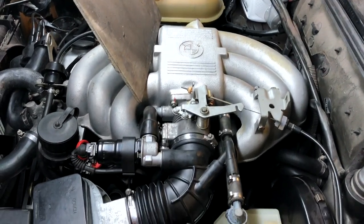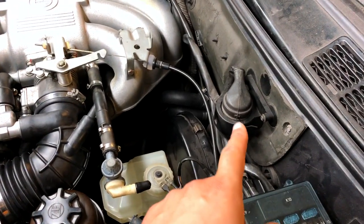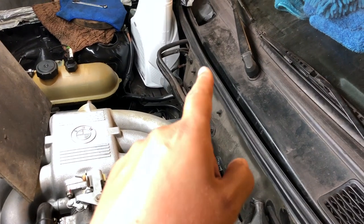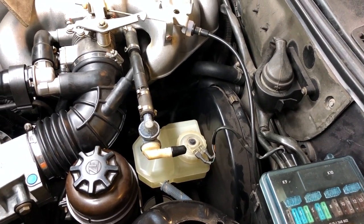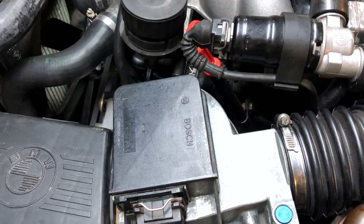So I checked the plus cable, the green wire on the coil, that checks out, everything is good there. I checked the continuity for wires in the C101 socket, that all checks out. I checked the small positive cable that runs from the battery and the fuse, that all checks out, so that's all good and great. And then I was measuring some things at the ECU plug, measuring for the voltages and the resistance for the CPS.